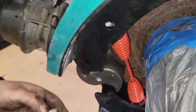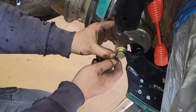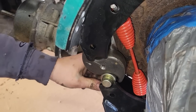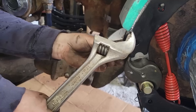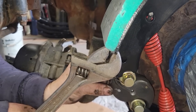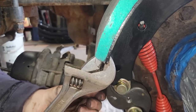To put the rollers in, these pieces of spring go in here. So they need to go in like this. Usually push down, get one in, squeeze those, and then get them into the retainers where they belong, like so. Just lift up, drop her in there, make sure you're not on your wire, like so.